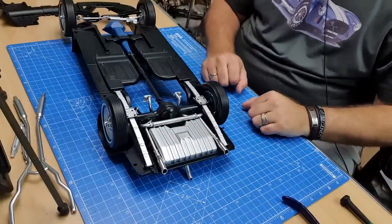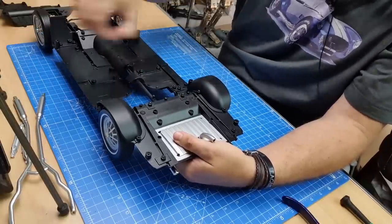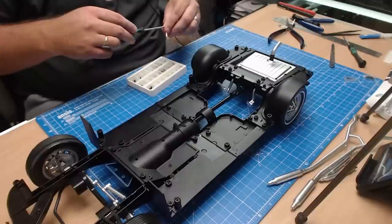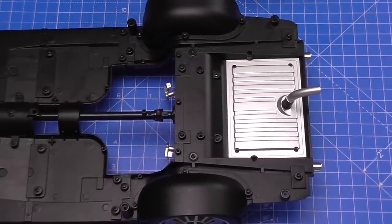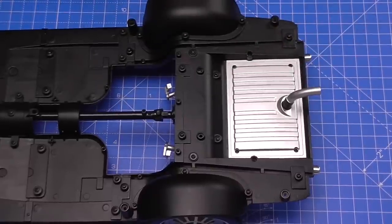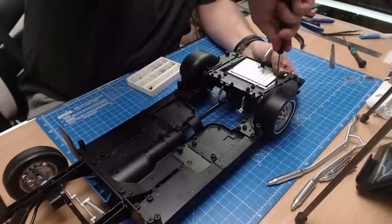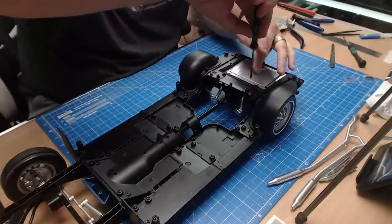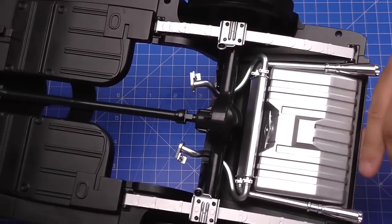When that's in place we're holding it down with MP01 screws. We're putting screws into the six holes that have now been created. I've got the MP01 screws here — I'll put this one in here, one this side, then one behind it. Now we've got two more: one here, and then the last one just here. That's all done on that side and the mufflers are now into place.